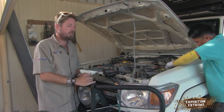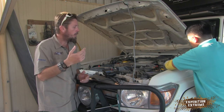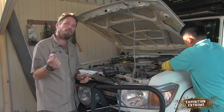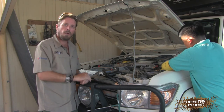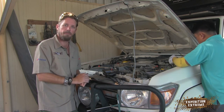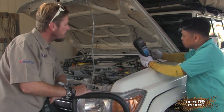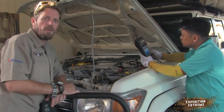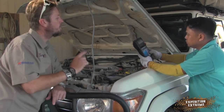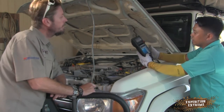So that's what I'll be doing tonight. Put it on charge right through the evening and get them up to the optimal full 100% level, which I said to you is anything between 12.7 and 13.2. So we're going to pump 14 volts into it now with the charger, and it'll go up and start trickle charging at about 13.7, which means my batteries will be 100% in the morning. What we've got now is 12.77, which is a really good charge. Between 12.7 and 13.2 means the batteries are at 100%. I do suggest, however, that you still put your trickle charger on for the first night and pump it through. Now the battery reading will be good.